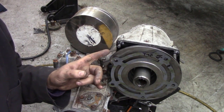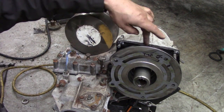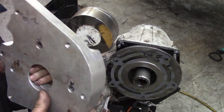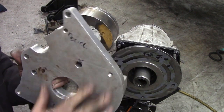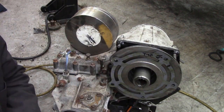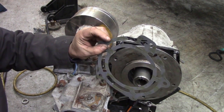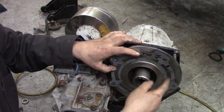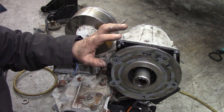What I did first of all — we had the rear flange copied off this. This is an adapter for another gearbox, but the guys at the CNC shop measured all this, so now that's in their computer and we can make loads of them. We also had a gasket that goes on the back of the gearbox, which let us copy the bolt pattern. And in here is the boss which sits inside the transmission.